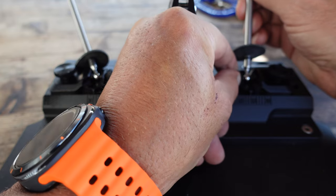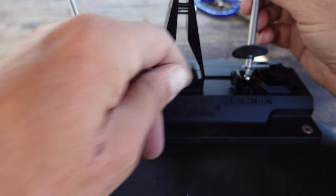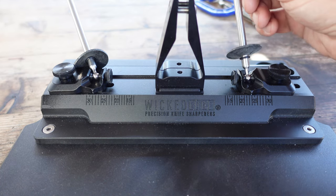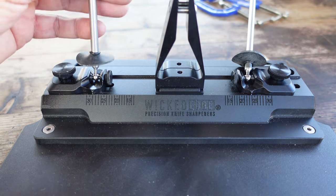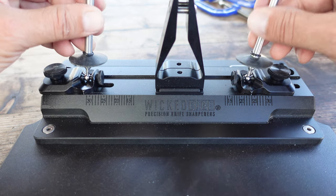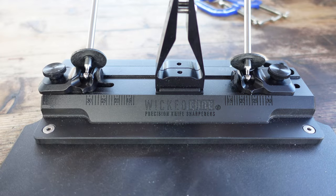Once you put the washer together with an O-ring, washer, O-ring, remove the plastic packaging ball. Place the actual ball that's attached to the guide rod into that little area, and you'll see that's a little socket, kind of the same way that your shoulder would operate as far as ball and socket. And then go ahead and just screw that thumb screw down, securing the guide rod in place. And of course, you'll do that on both sides.